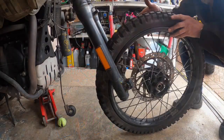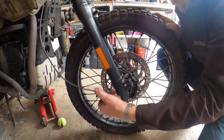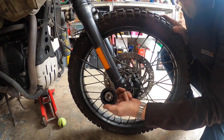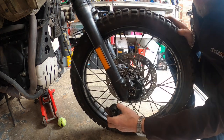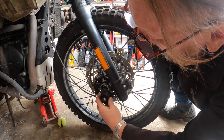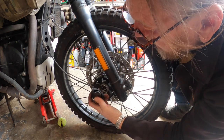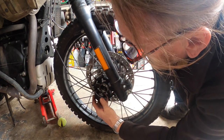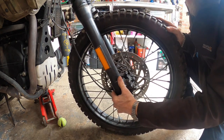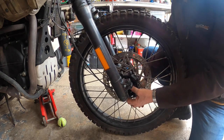And I'm just going to, you put the wheel in, get the wheel in more or less in alignment. Speedo cable, don't forget that. Now that's got 2 ears on the inside. See the 2 ears? That's going to line up with the 2 cutouts. That's the drive, so there's 2 cutouts there, 2 ears on there. So that, I know most of you guys, I'm teaching you how to suck eggs. It's no big deal for you guys, but it's so much to vlog, isn't it?